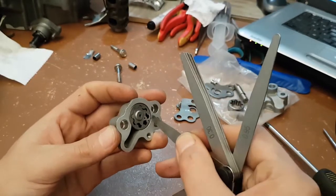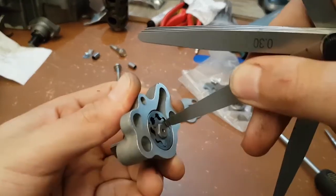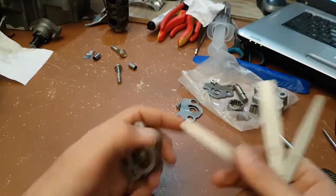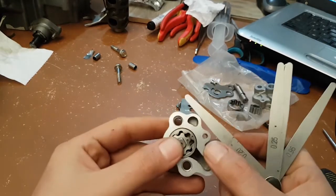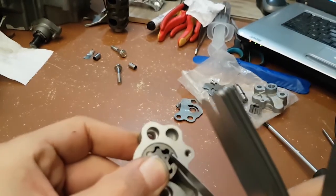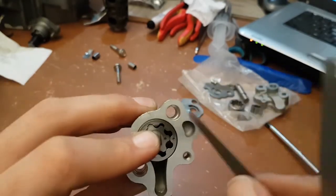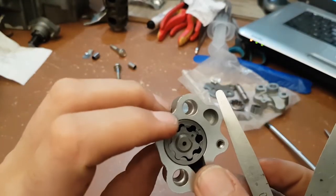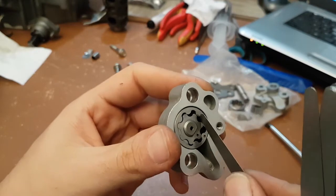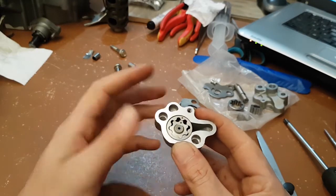As you can see, I'm not quite able to place the feeler gauge all the way — it catches just a tiny bit — so it hasn't quite reached the service limit yet. The other service limit is between the two rotors. You also make measurements across that gap, and it should be less than 0.20 millimeters. As you can see, I'm not able to place it in between any of these openings, so it hasn't reached the service limit either.